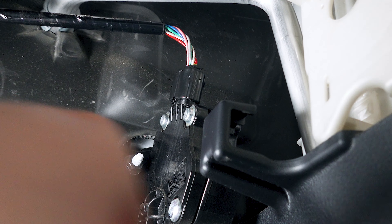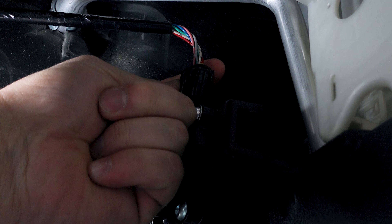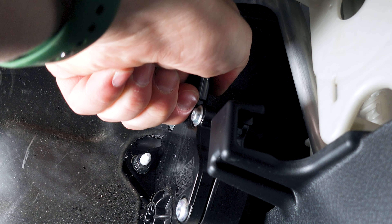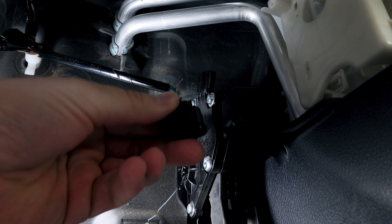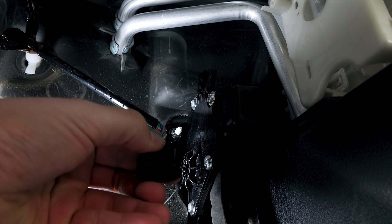Under here, by your brake and gas pedal, you'll see up on the inside where my pointer finger is — there is a clip that you're going to push in and lift and pull off. As you can see right here, there is that clip we just pulled off, and there's a button on the top that you push down and lift. Make sure you are pushing down on it hard and then pulling up, which will make it significantly easier.